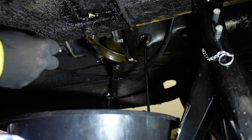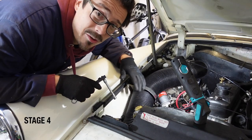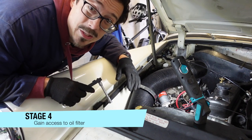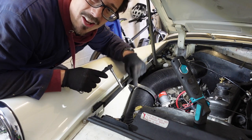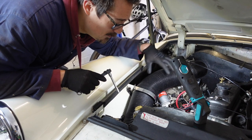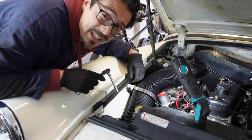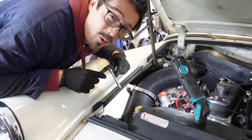Leave that to do its thing. We want to make sure we get access also to the oil filter, which is hidden annoyingly underneath the dynamo and underneath this hose and the steering column. The best thing I find is to take off and move out of the way this hose, and then you might have better access to getting your hand underneath and twisting that oil filter off.